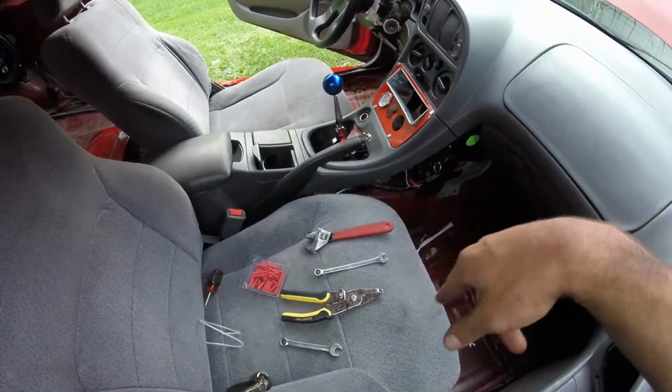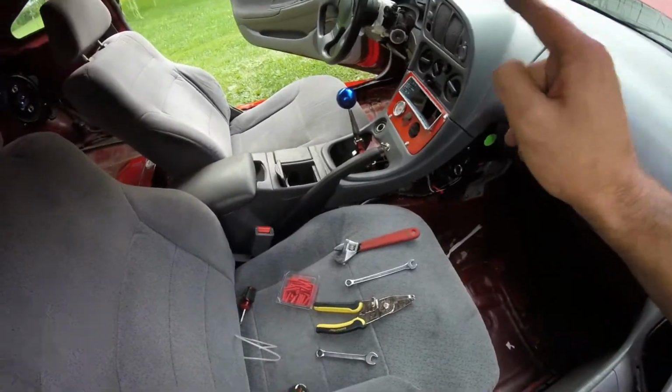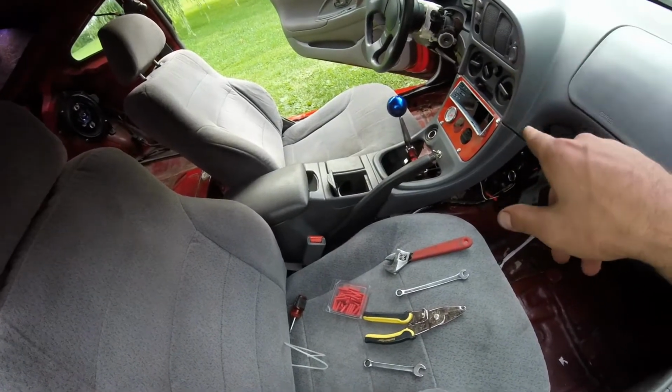And then hook the lights up for those, which once again is really easy because the light for the old cigarette lighter is still working, like the wiring still works. So I'm gonna use that wiring for the lights for the gauges. So I'm gonna go get to those, come back and show you guys the final result. Alright, I have nearly finished installing all of the gauges.